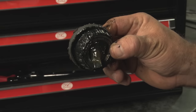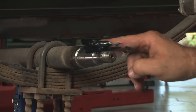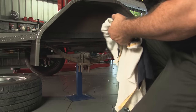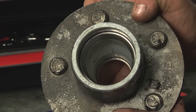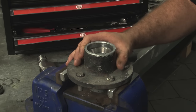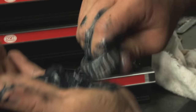Remove the inner bearing and seal using a hammer and punch. Have a close look at the spindle, checking for scoring, bent thread or other damage. A light coating of grease on the spindle shaft will make installation easier and also help with cooling. Inspect the hub bore and cup backing shoulder and remove nicks and burrs that prevent the cup from seating properly, using a file or fine sandpaper.